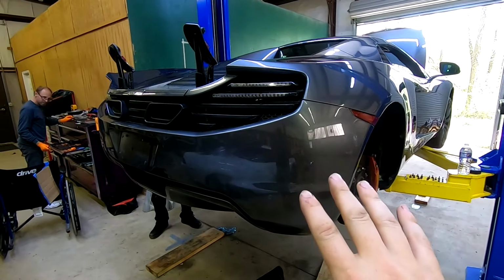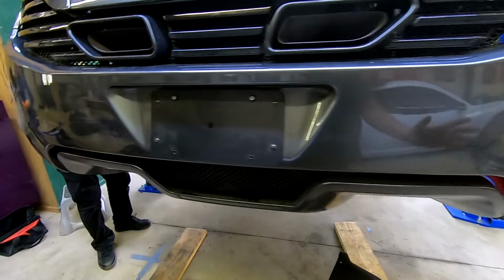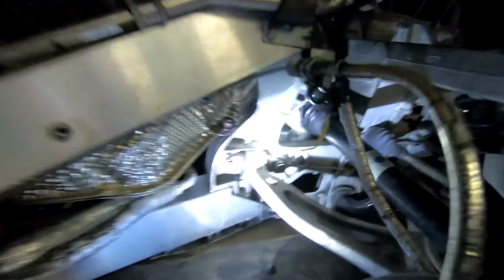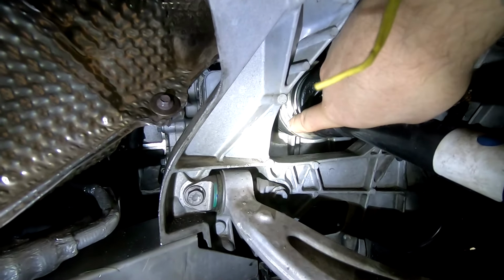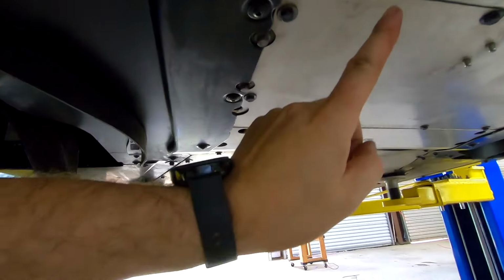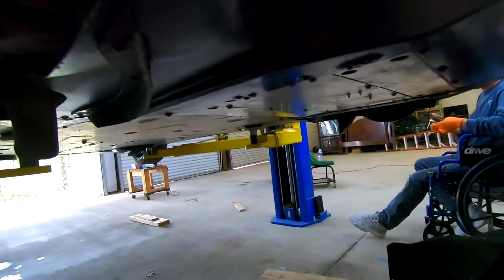Now, one other note, earlier in the video, we found an oil leak and we were not exactly sure where it came from, and we have found it because we cleaned everything under here. It was caked on, you saw it. We cleaned every single thing. But what is actually leaking is the axle seal right in there. It's really hard to tell, but right up against the transmission, that seal is what is leaking. The way that we discovered that is, remember, we cleaned everything up, and if we look very closely, which you won't be able to tell from this angle, there's a little bit of oil right around the CV axle. And then right below it, on the diffuser down here, it was slinging it just a little bit. We found a very, very small amount of it, and that's how we discovered what it was.